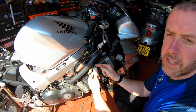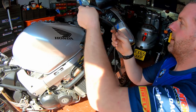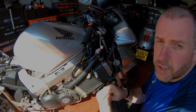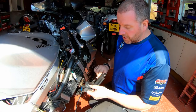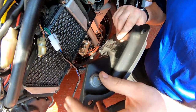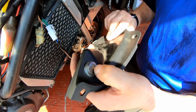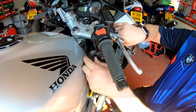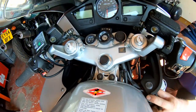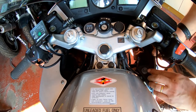This is a permanent live — it's live all the time, regardless of whether the ignition's on. Hence the reason for the rocker switch. Now, this is the switch I'm talking about — it's just a simple rocker switch with a weatherproof cap on it, because obviously it's going to be open to the elements. There's a little yellow LED light that will come on when the switch is on. This panel literally lives just there, and as you can see, it's quite accessible. Just even with a gloved finger, you could get down in here to pop it on or off as required.